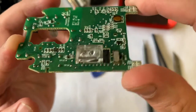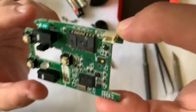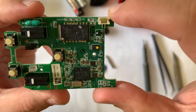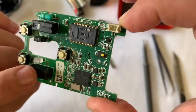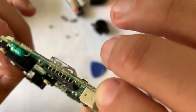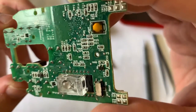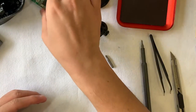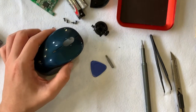The left and right scroll is using a 4-pole sensor and the left and right switches are Omron. The scroll wheel is using a light sensor and the center click is also a 4-pole one. In the future if you are replacing these parts, they are fairly available. In case you have a damaged mouse, don't throw it away — keep it around. Who knows when you need to harvest some parts from it.